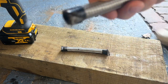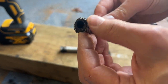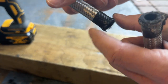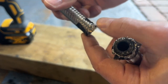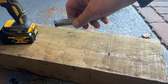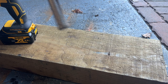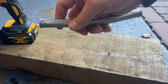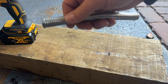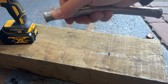There is the end of the hose — it's pretty good actually. By the time you've got a hose finisher on there, it hasn't snagged or pulled the braiding too much like a hacksaw might. I could have done a couple more wraps of masking tape, but this is the end I want so that'll do just fine. With the masking tape removed, the ends are absolutely perfect — the braiding hasn't undone too far. Another benefit of a multi-tool is that because there isn't much movement in the tool itself, you can do it in situ in the engine bay. Just wrap the masking tape as tight as possible.